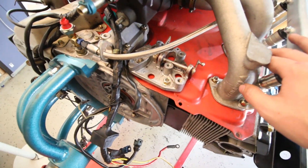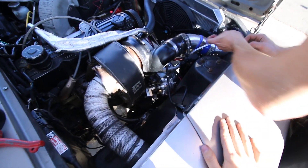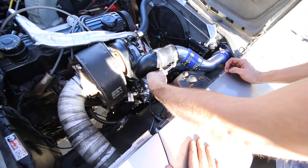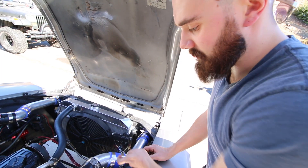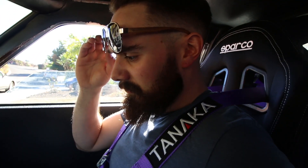We're ready to put the motor back in after we pick out a clutch, put on the flywheel, and tighten everything down. Looks like Devin's finishing up the Datsun too, so we'll have to go for a test drive to make sure it charges. We know it will — it's whether or not it's gonna burn out the alternator. We might have to monitor the laptop from now on even if we're not tuning — just have it hooked up so we have the voltage meter in there because it's not hooked up to the gauge.